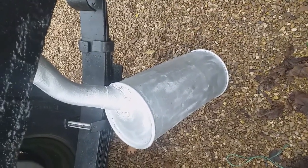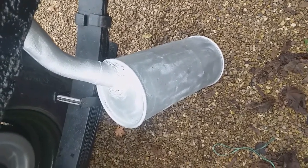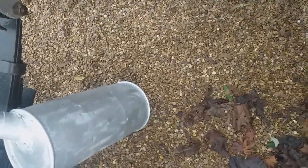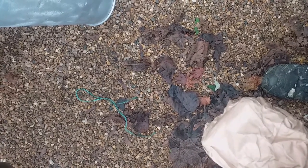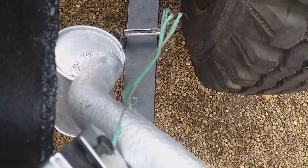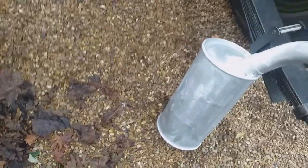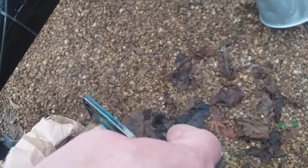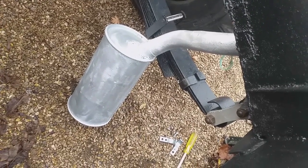The silencer box has got a little bend and I want it to attach to this square end under that cardboard. I've basically attached the tail pipe to the mount with a piece of string - it allows you to get the rear box in the right rotation at the right distance so it links up with the four-piece. All I have to do is get the gasket, put them together, then when I go to clamp it I'll know where to put the clamp and I can support it with a jack.